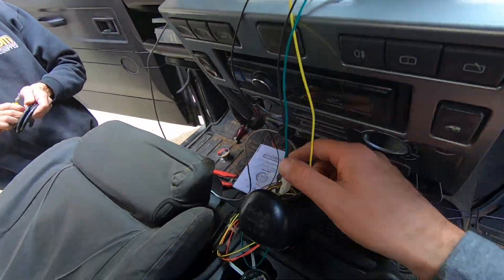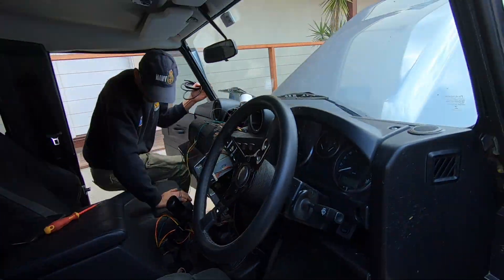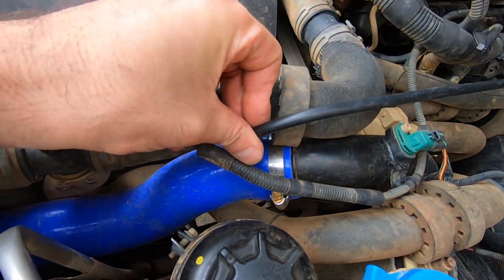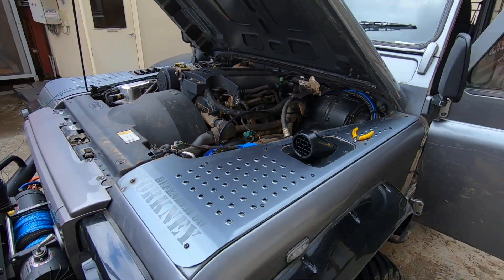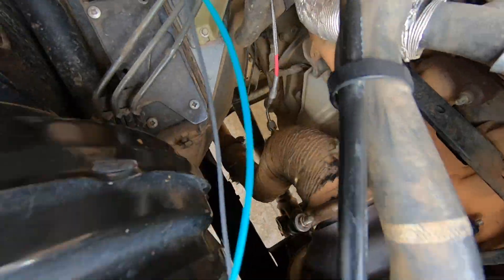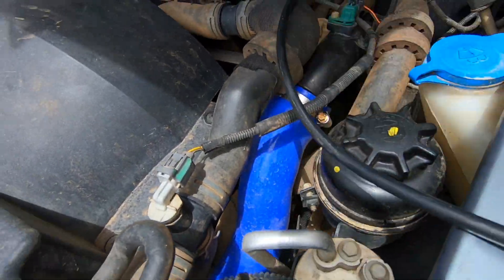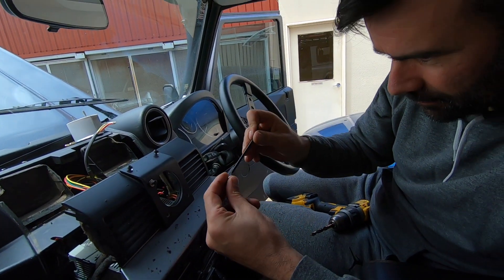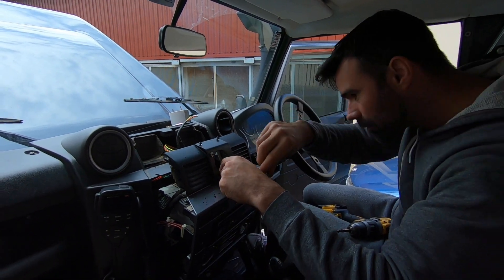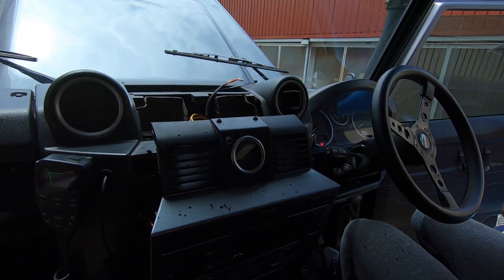The green one is the coolant wiring probe. I mounted the two boxes from the gauge under those vents, and on this side of the car we ran the boost hose. As you can see, the EGT wiring and the coolant wiring are going through that side. Then it came time to actually bolt the gauge in permanently — it comes with a backing plate which goes over two bolts on the back of the gauge, and you just put a couple of nuts on there which backs onto whatever is on the inside and holds it in place.